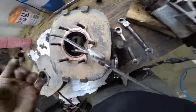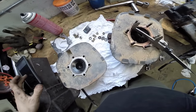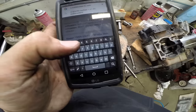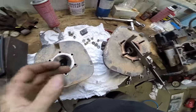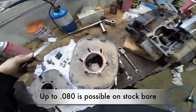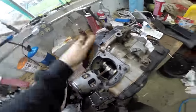We used dial calipers — this is a crude way to measure bore; you should use bore gauges, but we're waiting on ours to come in. We're going to bust out the adjustable hones, so we'll be able to do the boring in-house. But we need to buy a new piston because this one is shot. So we're going to pull the wrist pins — I'll show you a little trick on how to do that — and then our piston and cylinder will be off and we can focus on breaking down the bottom end.